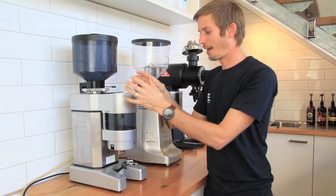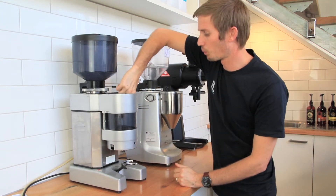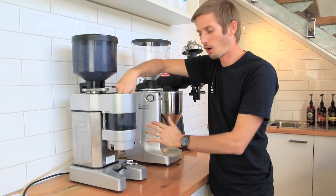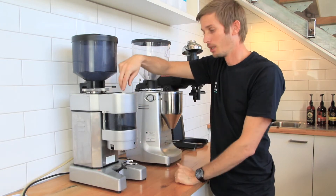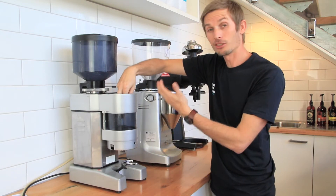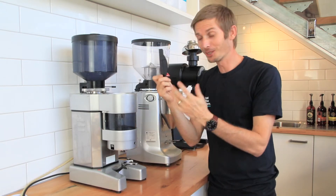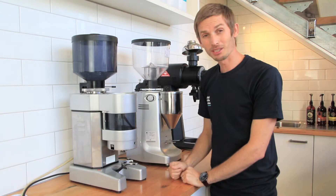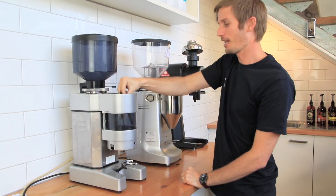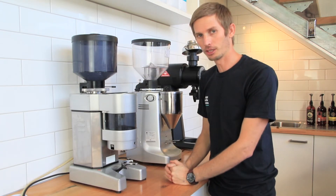This grinder, having a dosing chamber, is slightly different. It'll have a switch up the top. The design of that switch is to engage and switch the grinder off when the hopper's filled up. Sometimes they can get stuck. Make sure that it's moving freely and that it's not stopping your grinder from engaging. Also, if you're using something like a dosing tool and it's dropped in there, it could be holding that switch as well. Clean everything out in there, make sure that switch is moving freely, and then try to engage your grinder again.